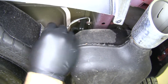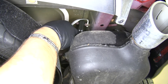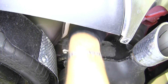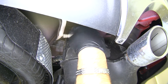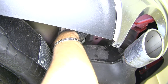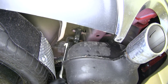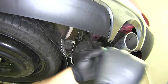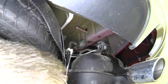On the inside toward the spare tire you're going to notice this strap. You want to pop that off and just let it hang there because we're going to put it back on later. Sometimes these hangers are a little difficult to get off, so you're going to need to use a pry bar. This strap that we took off down here — I'm going to go ahead and put it back on down here and take it off at the top, that way it doesn't get damaged when we put the pry bar out there. Then we're going to repeat that same process on the other side of the vehicle.